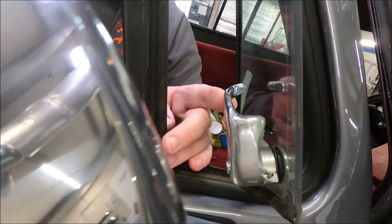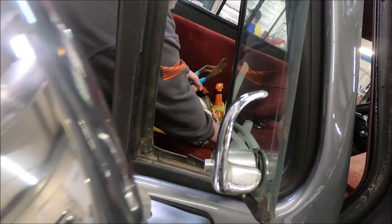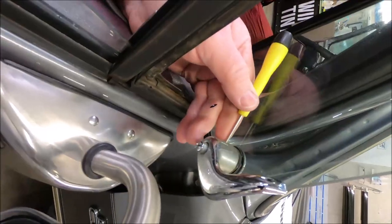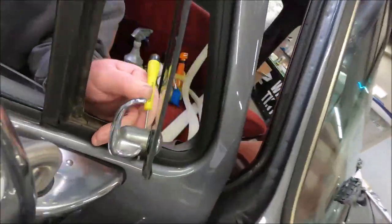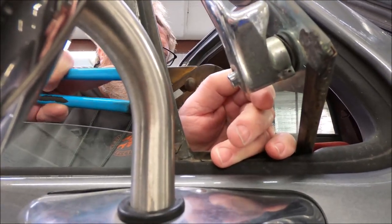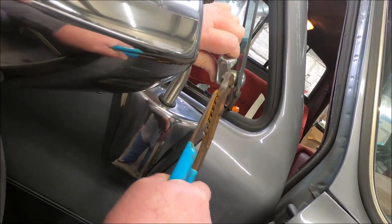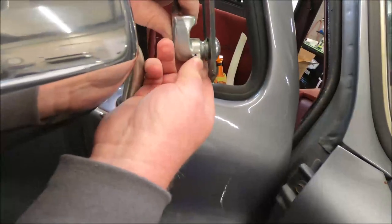What I'm gonna do — I've got this thing started to roll the pin here that you drive out. I'm gonna show you an easy way to break the glass, but the only way to get it out is with a roll pin driver. I've lost my hammer, so this right here is redneck hammer time. There's a hole up here on this side but it always drives out through the bottom. Get this thing started to drive the roll pin out.